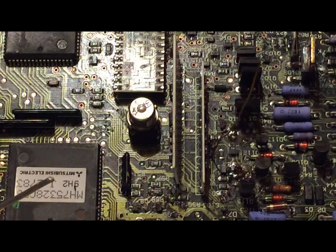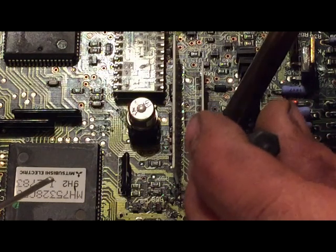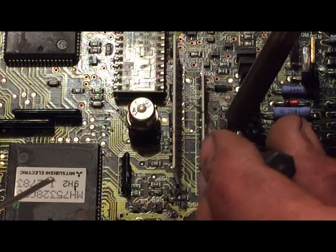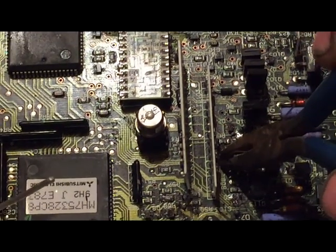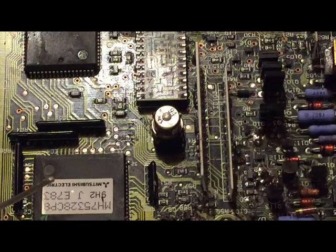Sorry for a boring video here guys - it's just kind of the process of how these videos go. If you're sitting there and you've got one of these computers that are bad, it means you're not running your vehicle and you're in dire need of getting this done. It might be worth it for you. And if you do it and it doesn't work, just keep on doing it because you missed one or two connections. Keep going until you get all your connections done. This one had quite a bit of corrosion on this board.